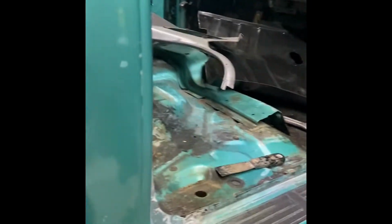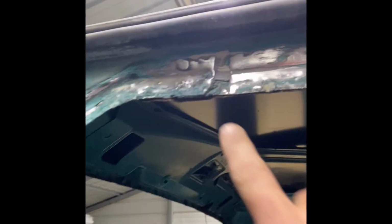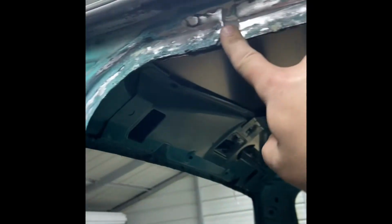All right, guys, so I had to take a little break and go pick up some stuff from town, but I went ahead and installed this rear cab bushing on the passenger side. Then I went ahead and ground and cleaned up all around the door frame. So what I've noticed is that they actually put this whole cab side on before. And the reason that this had leaked so bad is because this actual pinch weld around through here was turned completely towards me, which that's not correct. It should be straight as you're looking forward as you go around it and so on.